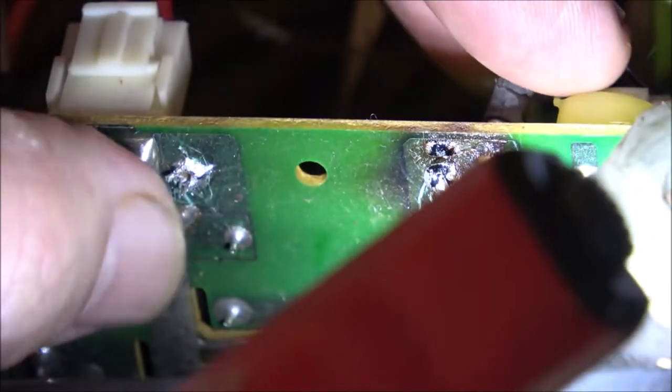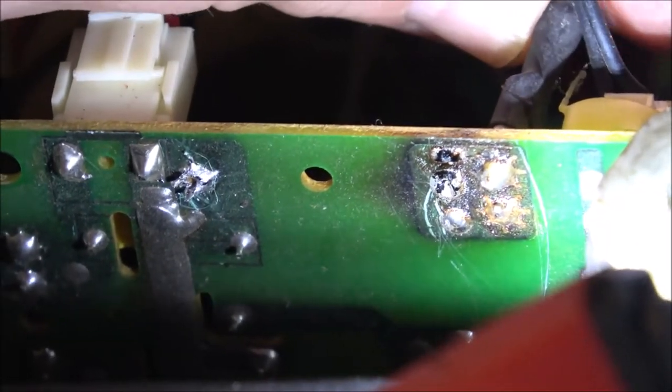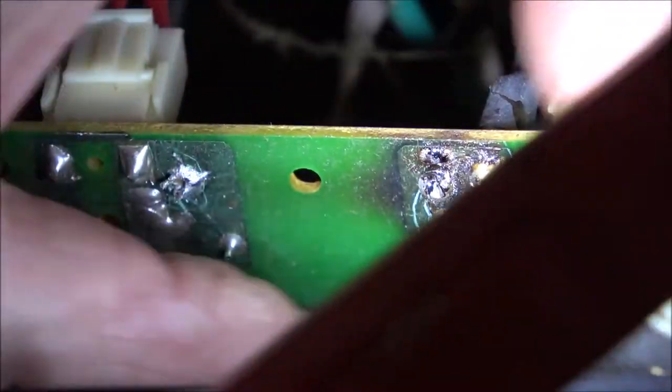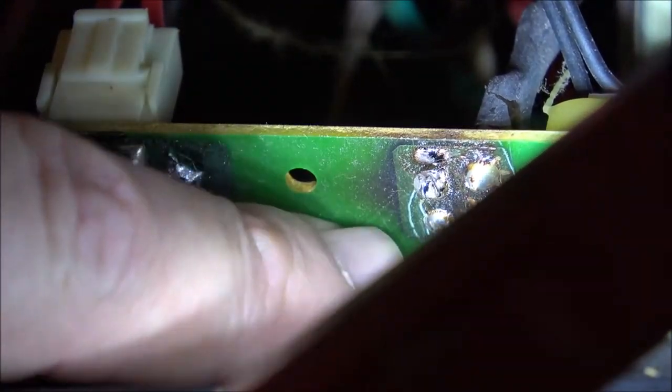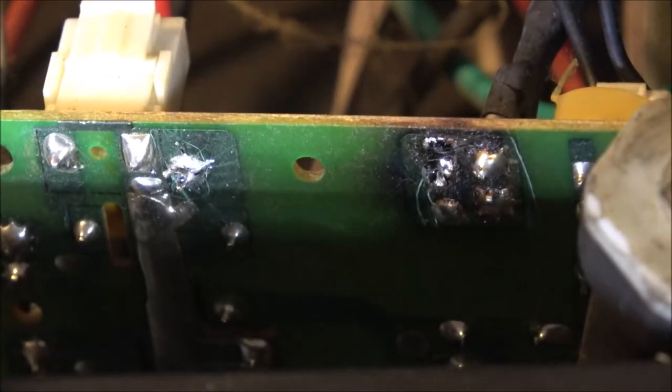As you can see, it's a little dark around this area here. I'm going to try to reflow whatever that is. It still feels tight, so I might reflow that bottom one. I don't want to mess around with it too much because my soldering iron is not the greatest. Let me get this wire straightened out and cut off where I need it to be, and I'll bring you back when I try to solder this back on.